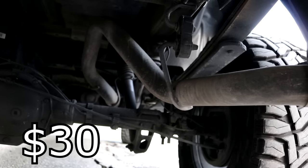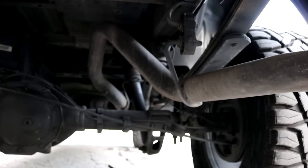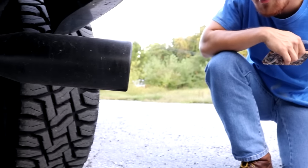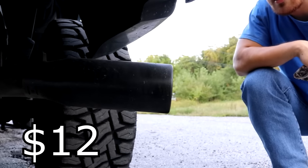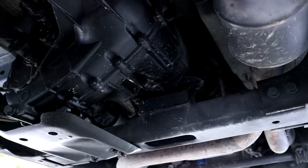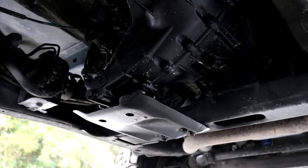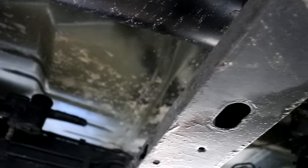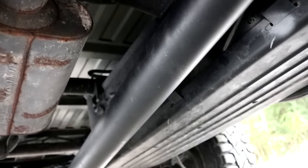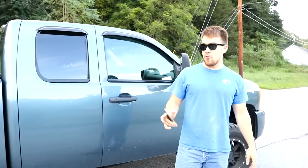I bought about five cans of spray paint — black high-heat paint — and painted from the exhaust tip all the way to the muffler, up to the cats, and to where it connects to the engine. I found a Flowmaster exhaust tip on the road, installed it, and it fell off. The current one I bought for 12 bucks at a discount store, sanded it down and painted it black. In total over four years I've spent about 600 dollars on roughly 100 cans of spray paint, coating the frames, drive shaft, axle, and all suspension components because we're in a rusty, salty area.